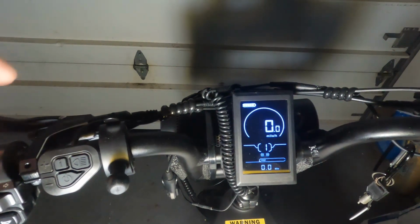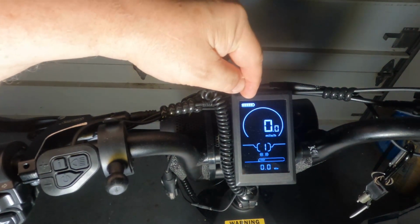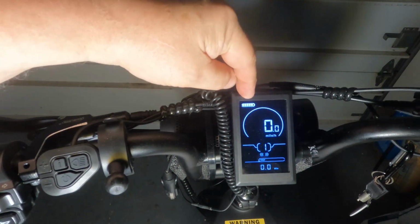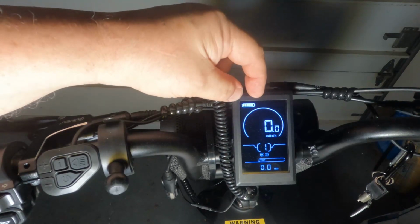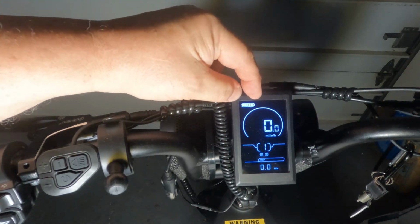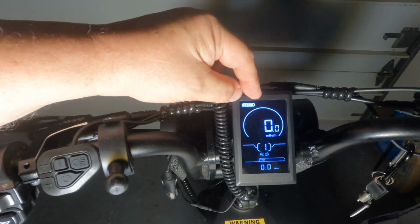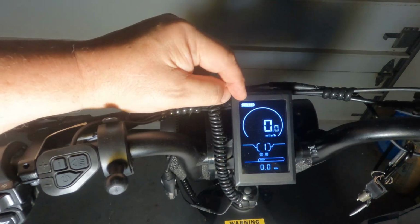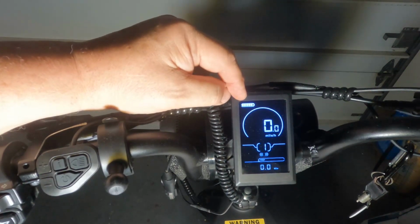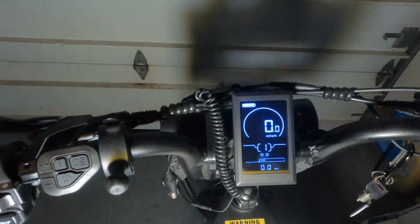The third item to be addressed is the battery bar gauge or fuel level in your bike. As it comes from the factory, it is set up in a way that has 2 problems. The first bar is roughly 40% of your battery capacity, not the 20% that you probably were expecting. And the last bar, if you get there, is a voltage that is dangerously low and at risk of damaging your battery. So we never want to even get to that point.